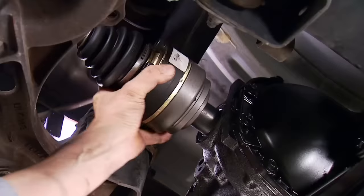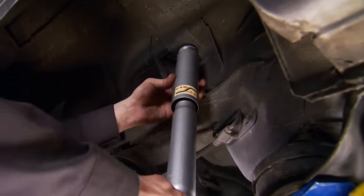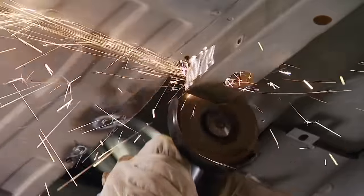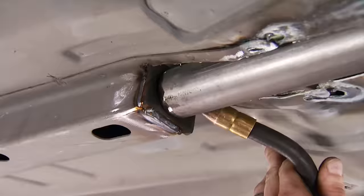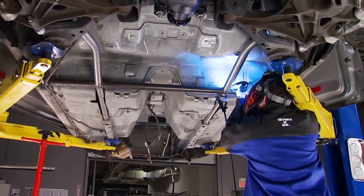With it back in place, we gave it a pair of more durable half shafts, springs, shocks, and better brakes, followed by a stiffer rear sway bar. We built our own subframe connectors that'll keep the bird's body stiff when we give it a brand new source of power.